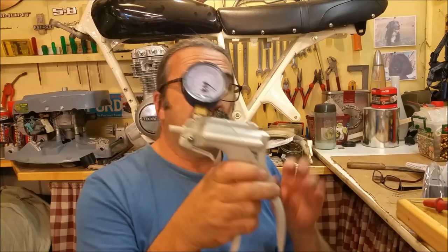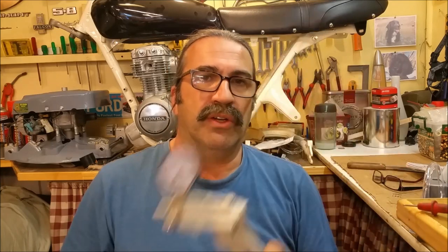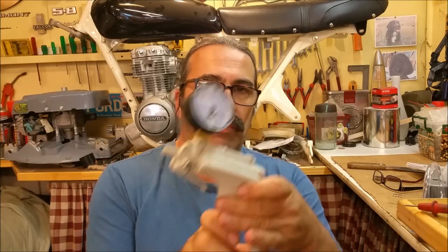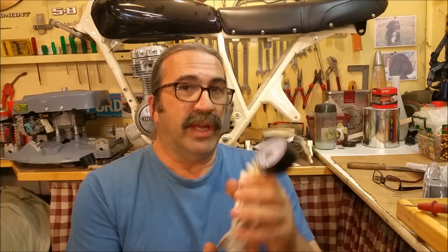Now, particularly with this guy, I'll use this on the XD because I've got problems with the climate control on it, or the heater if you like. There's no air conditioning on the car. But a lot of the time, if there's a problem with the switch, you'll pick it up with that. Instead of blindly replacing vacuum motors on vents that are supposed to be moving, I can check those motors by putting this on and pumping it up and seeing if the motor holds vacuum. That's got a gauge on it. It's absolutely perfect. So Nick, if you see this, thank you ever so much. It's absolutely wonderful, and I will get good use out of that.